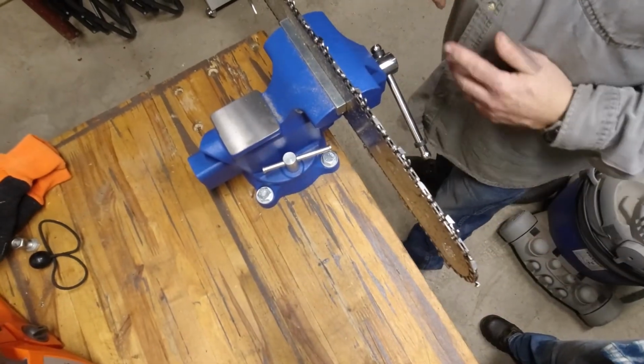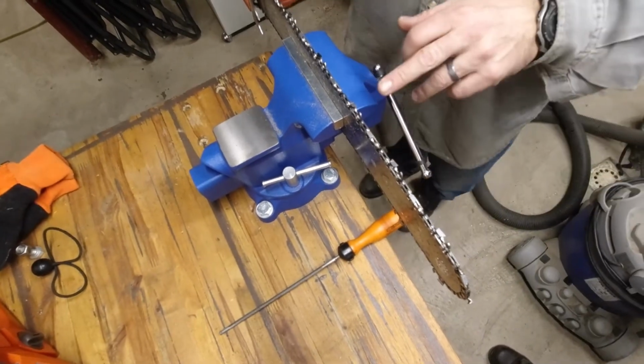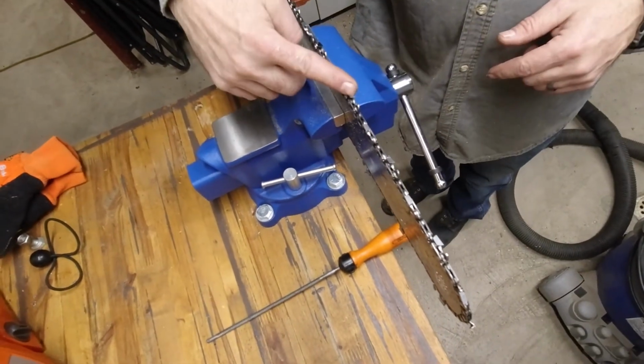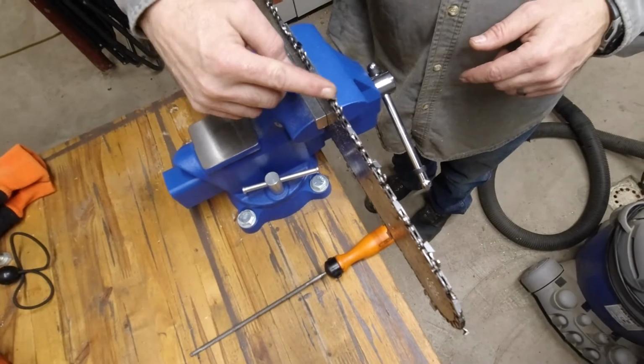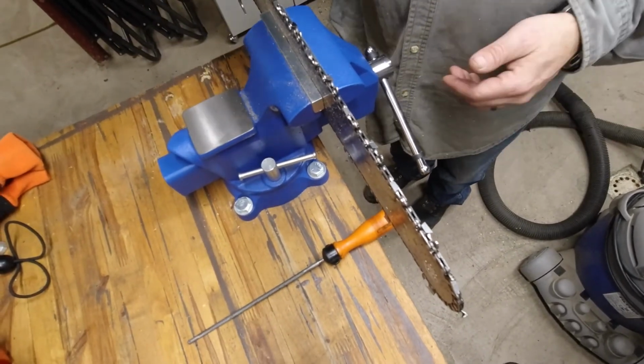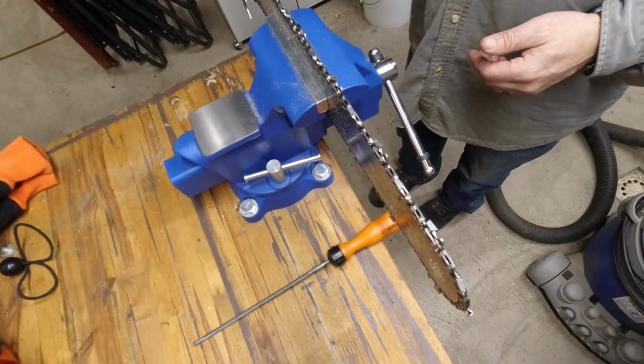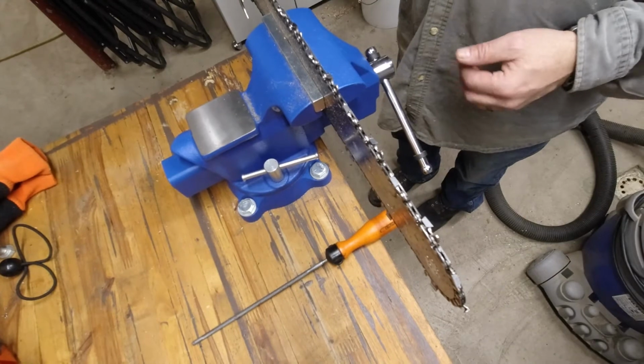And we're back to our reference tooth. First few times you do this, you'll invariably make one side straighter or more angled than the other side. It'll cause your cut on your firewood or logs to curve. We call it butterballing.